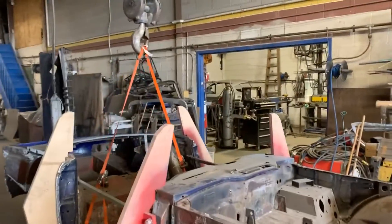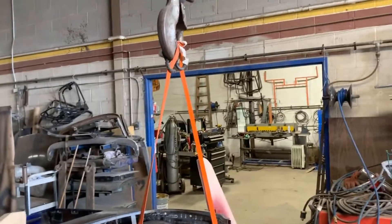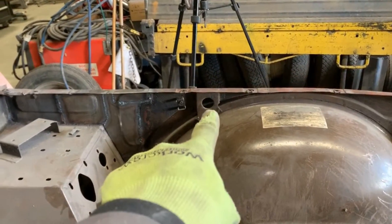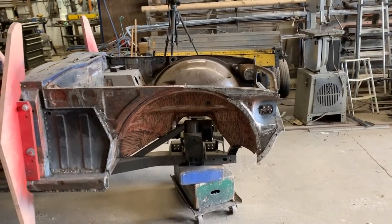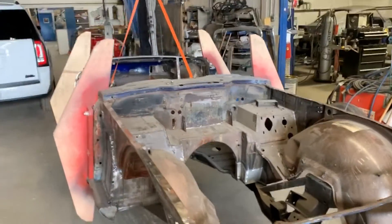We are ready to lift the body — it's hooked up. I use the mounting points for the seat belts at the bottom of the B-posts, and these are the only two points I hook the car up to. Many people prefer four straps, but I don't think it's necessary. Chef Tash uses rear fastening points and front holes too, but once I hook it up and lift it, the front of the car is so light I can carry it with just one hand. If I need it balanced, I just run a third strap to the center.